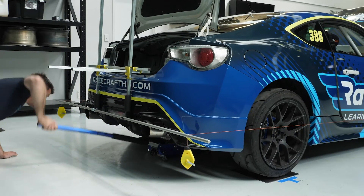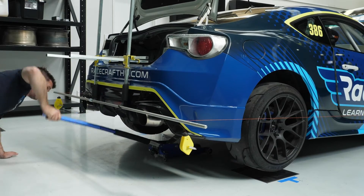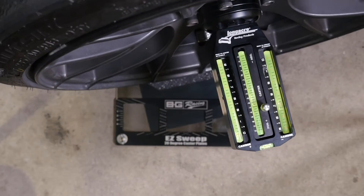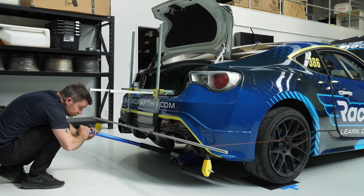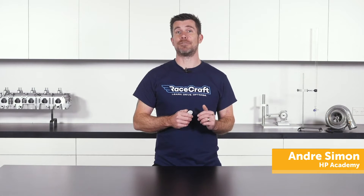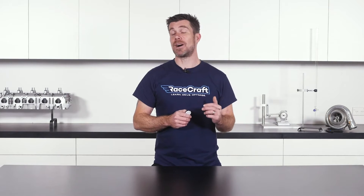One of the common tasks we'll be performing while making adjustments to the suspension is to jack the car up in order to reach the various components that we need to access and adjust. This might seem like an obvious detail, but the part that's easy to overlook is that when we lower the car back to the ground, the tyres and suspension will not settle back to the same position they were in before we jacked the car up. This is due primarily to the fact that the wheels tend to move inwards towards the chassis centre line at full droop, which is what happens when the car is jacked up off the ground. When we lower the car back onto the ground, the tyres contact the ground and they tend to bind up because they can't easily move outwards to the position they'd be at in a normal ride height. This means the car will sit higher than it should and all our alignment readings will be affected.